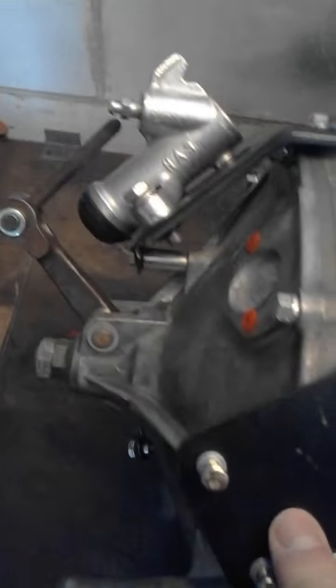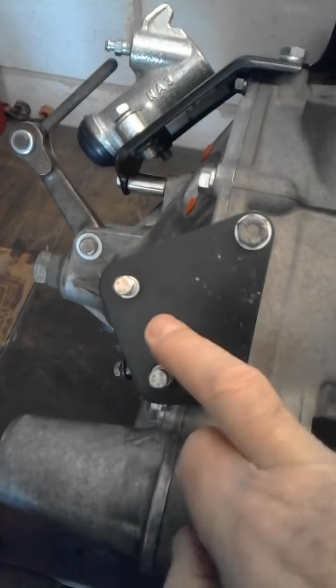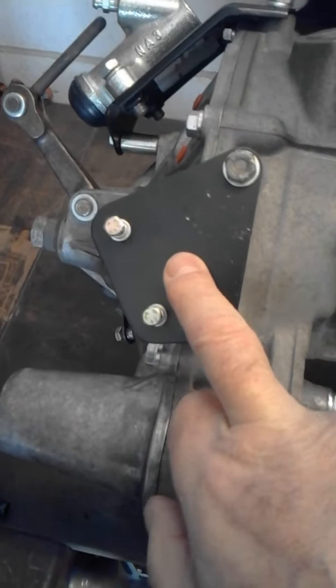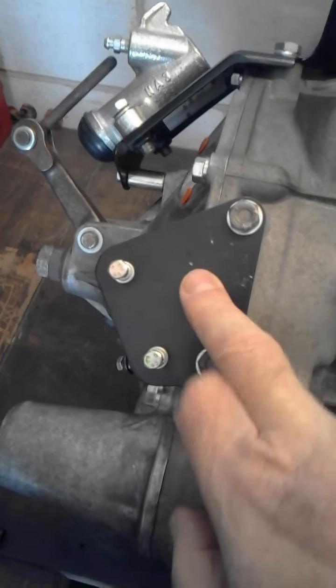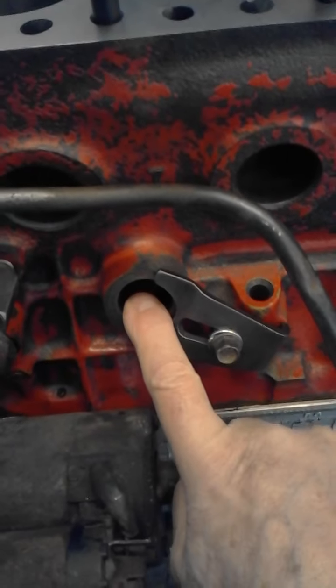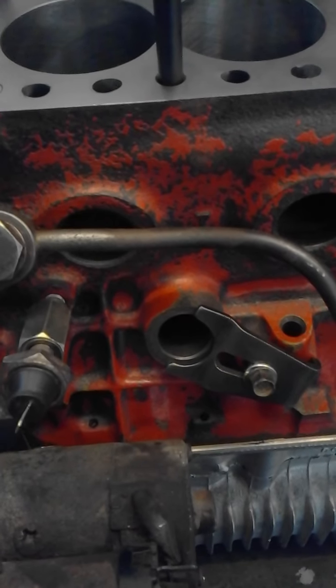New parts — this will be the bracket. I'm not too sure where it's going to be: the MPI-style coil pack, or a Ford flat-base coil pack, or I might even just go to coil packs in the head. I'm going to use the standard distributor but fit the BMW hall effect sensors in it.